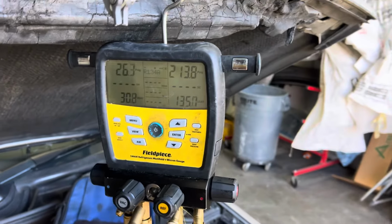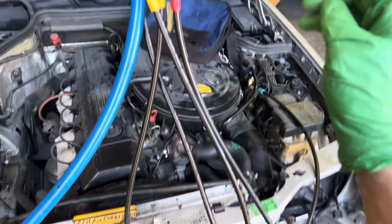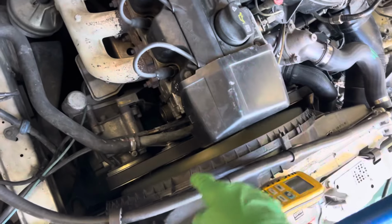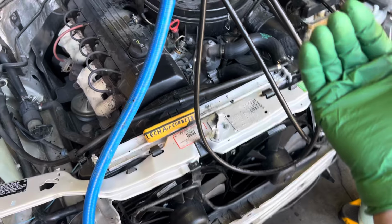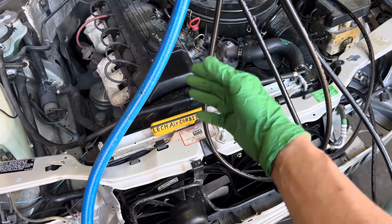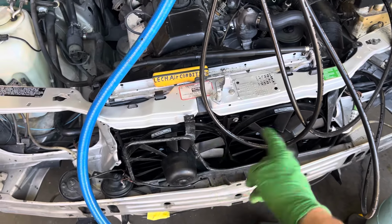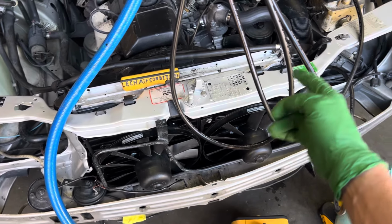What I would normally do to test, to make sure that the customer has working fans and that their relays are good, the fuses are good, the pressure switch is good, I normally do what you shouldn't do. Somehow I would make that fan stop, and I won't tell you how, because nobody should ever repeat this. And I would drive the pressure, let's see if I can get some newspaper up here, drive the pressure of the condenser by stopping the airflow, drive it up over 270, and that should kick on the switch to turn on the fans. And if the fan doesn't turn on after 270, say it goes up to 290, 300, you know the fan circuit is not working off the pressure switch.